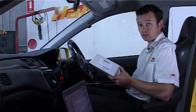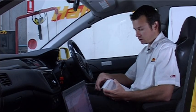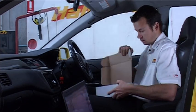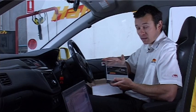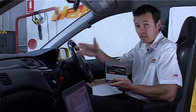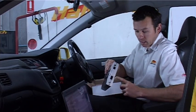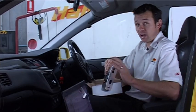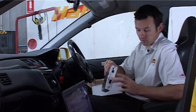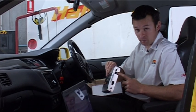When you purchase your Haltech Evo 9 Platinum Pro plug-in, you get the ECU. This computer plugs directly into the factory Mitsubishi harness. On the back of the ECU we have an auxiliary breakout connector for additional outputs that the factory Mitsubishi harness does not have. There is also a communications connector and of course the CAN port.